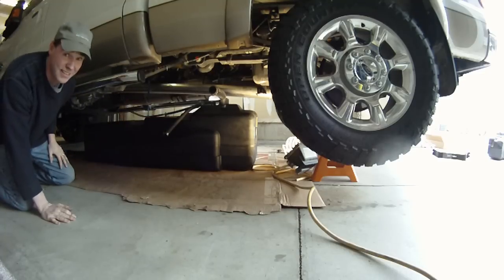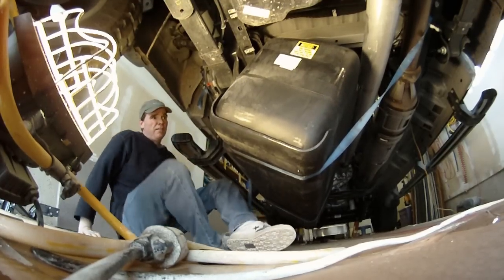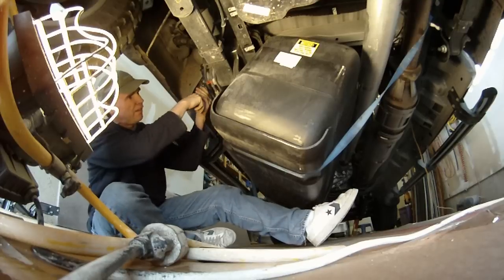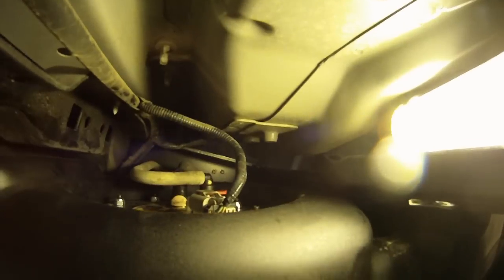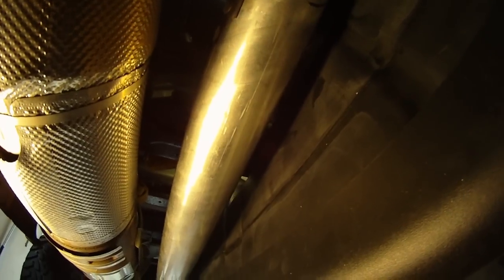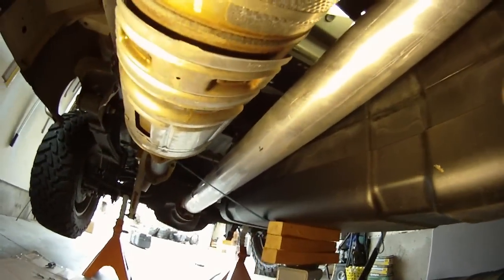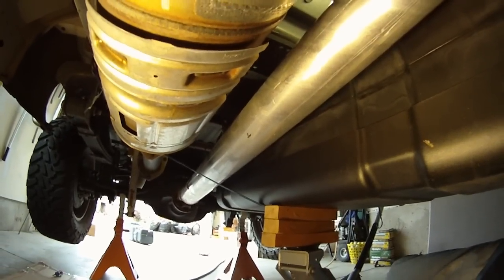Boy, that's big. Making the connections up there are really, really tight. You just kind of have to muscle your hand up in there, and do it all by feel. The connectors all just click on with a little positive lock. So I'm going to go ahead and put the straps on the tank, then connect up the fuel spout, vent lines, and breathers, and we should be done.